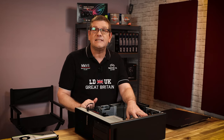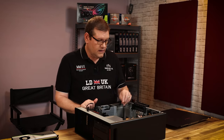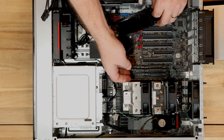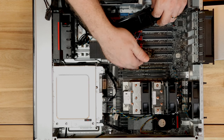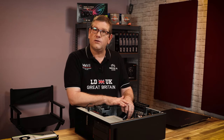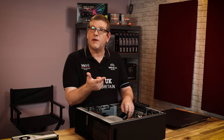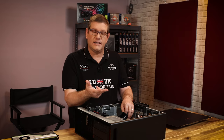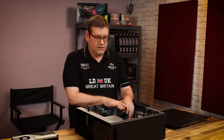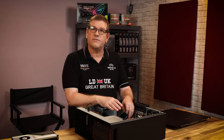This board supports ECC memory up to two terabytes — that's another one of the main features of this machine. It does have RAM coolers that are easily removed. Currently only two slots are populated on either side, so we're using four of the total eight slots. The main benefits over a desktop system are the higher core count, eight channels of memory, and 128 lanes of PCIe. Even if desktop machines are high-powered with up to 16 cores, they're still not going to have these options.